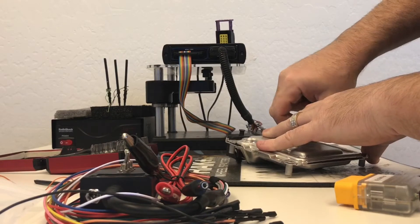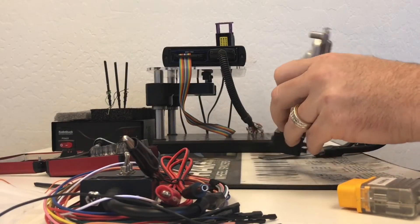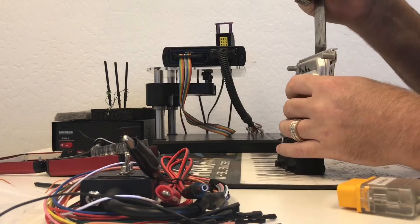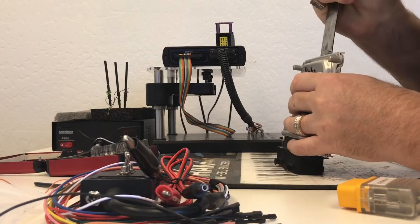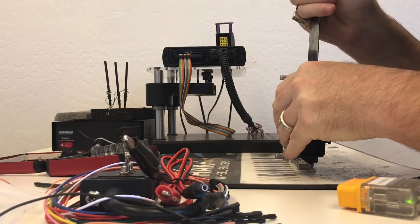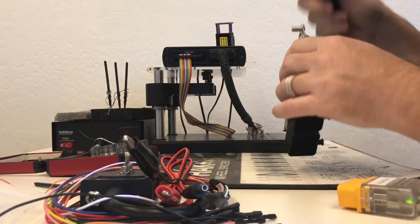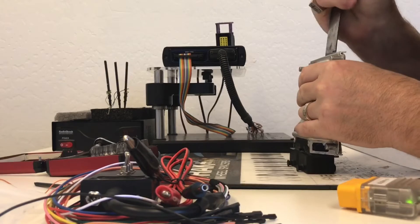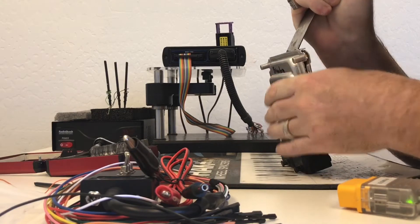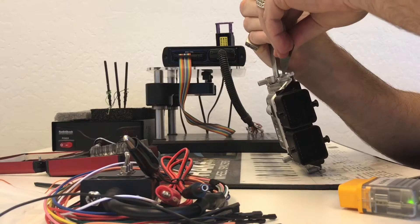You have four screws. Now with the screws out, it's time to open the ECU. Since it's already been opened it should come up pretty nicely. You can use a putty knife and go in here and slowly pry open the ECU. With the material heated up it's a lot easier to open. Sometimes you can use a razor blade and cut the silicone.